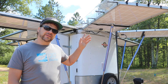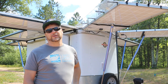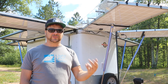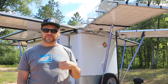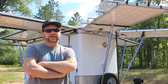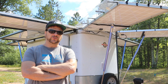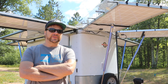You'll notice on these panels here you can see this polycarbonate. We did put a layer of polycarbonate on the front of these panels since those are going to be the ones most vulnerable to rocks coming up. I also did a little bumper on the front of the bottom edge of that panel to make sure we have a good defense against rocks in that particular area. The sides, rear, and top are not as much of a problem, but it is those front two panels, which is why we put the polycarbonate on there.